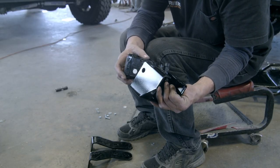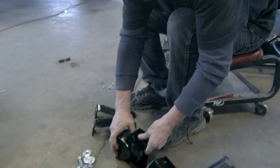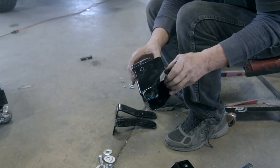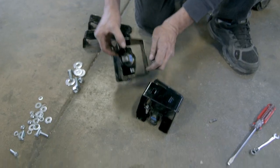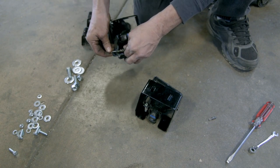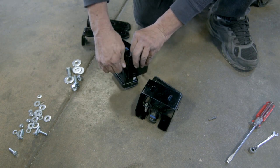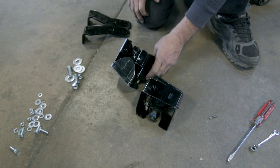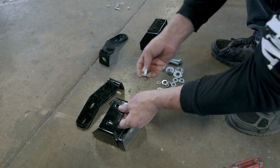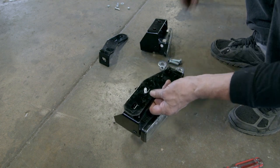Now it's time to install the factory driving lights. The brackets for each side are exactly the same, so don't worry about which one goes where. The new bracket has a hole on each side where the factory lights fit in. Place the screw and spring back into place and tighten down. Use the screw as an adjustment to make sure the light is parallel with the bracket — this ensures that when you mount the light it will be level on the road. It may help to mark the sides of the light and the bracket with a white paint pen to make them more visible. Bolt the elbow bracket to the light bracket you just assembled, using a bolt and a nut with the washer on each side.